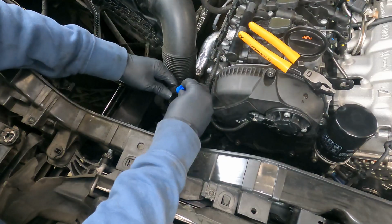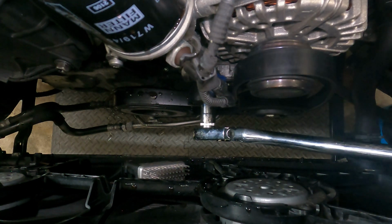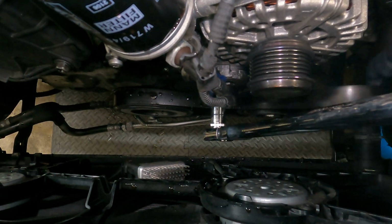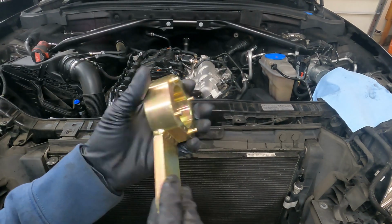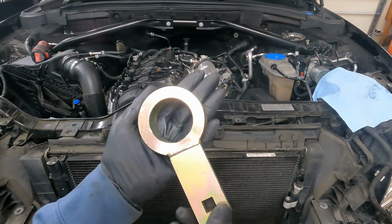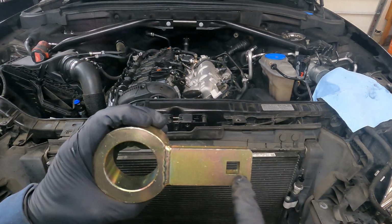Also, a fun fact, if this is open or you disconnect this and you open your door with the battery connected, that will squirt out coolant, we learned. So here we're removing the tensioner, releasing the belt, and getting that out of the way. Here is the special tool you'll need to remove the crank pulley on these 2.0 engines. There's a link in the description below. Definitely need this tool for this job.